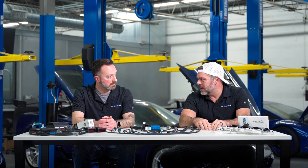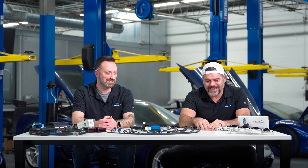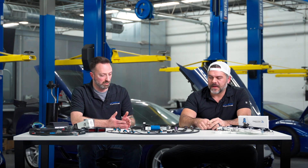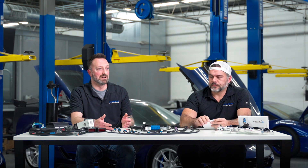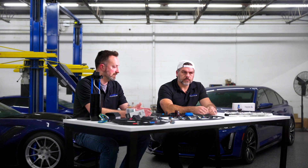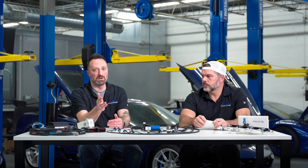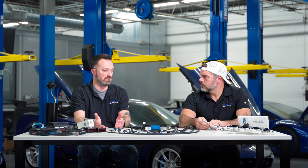Timeline — that's people's number one concern. When do you think they can have it? Well, not two weeks. We obviously want to flesh this out. When it comes to the actual port control function, it seems simple, but there's probably eight months of hell that the Camaro had to survive at wide-open throttle on the dyno for 2,500-plus miles just pouring through everything. This isn't going to be any different — we're going to want to make sure this has been fleshed out and functions the way we want it to. One thing we're talking about is adding a parameter to control the response time of the actuator. This thing is stupidly fast, but you may want to turn that down — just because you smash the pedal down, you may not want this thing to react as fast as your foot does.